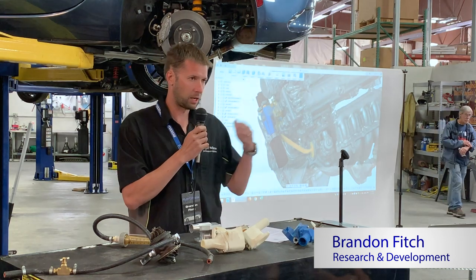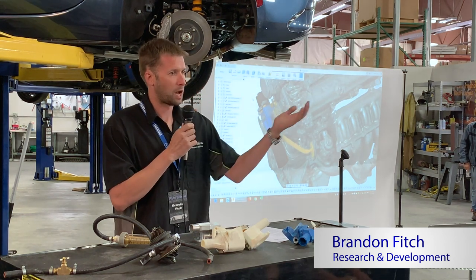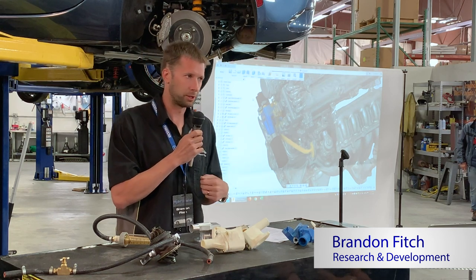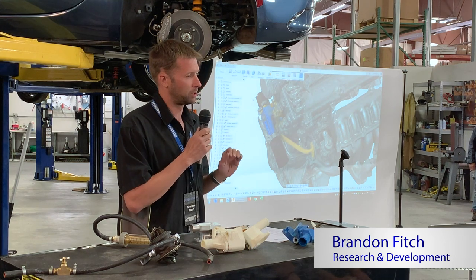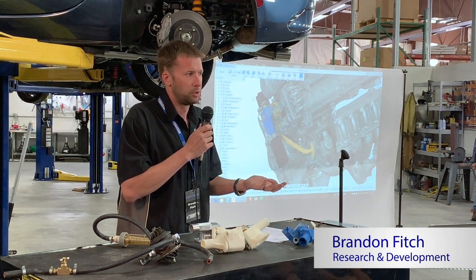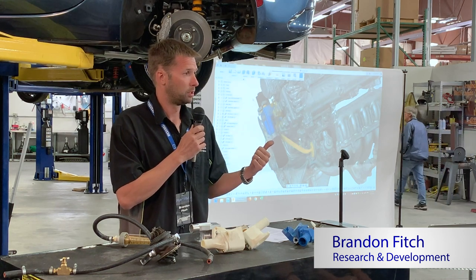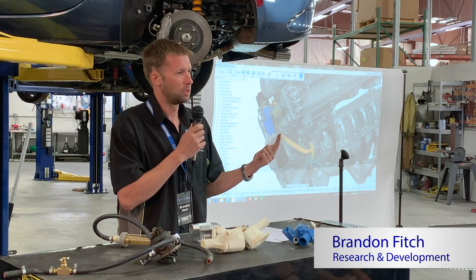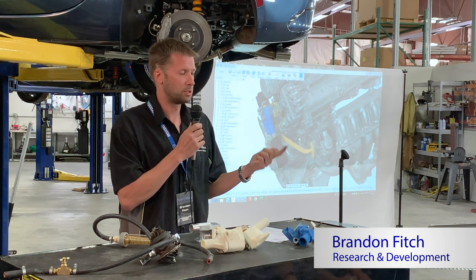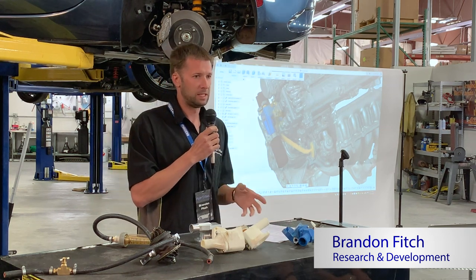Like I was saying earlier in the new products, typical turbo routing, and this applies to the Mazdaspeed as well, Mazda did this exact same thing. It takes hot water from the engine, makes it hotter, and puts it right back into the engine. No cooling whatsoever. So what we wanted to do, without making it really complicated, there's no way to get cool water to the turbo. And it doesn't really matter, because you're not really cooling off the turbo during operation. So we're still getting hot water to the turbo, we're still making the water hotter, but instead of running a lot of water through there, and instead of running that hot water straight back into the engine, we're running less, so we're putting less load into the coolant, and we are putting that heat into the heat exchanger, so it can dump that heat, hopefully as much as possible. That was the big premise.